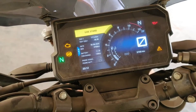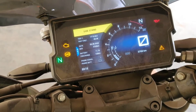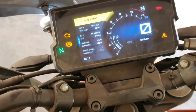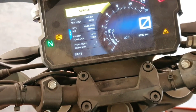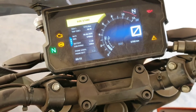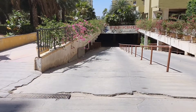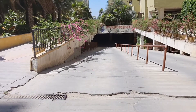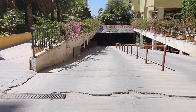Here you can see the battery indicator is showing 11.7 volts, so it won't crank at this voltage — at least it needs 12 volts. So we'll try some old school method; we'll try to push-start it today. I will use this ramp to push-start it. I'll put the bike in second gear, and when it hits 20 kilometers per hour I will release the clutch.